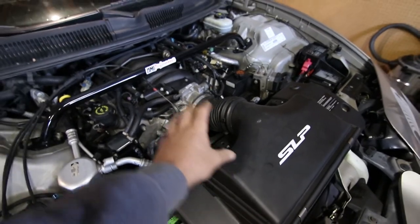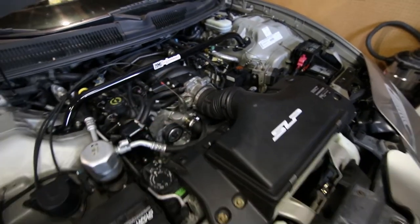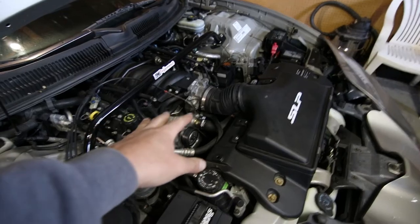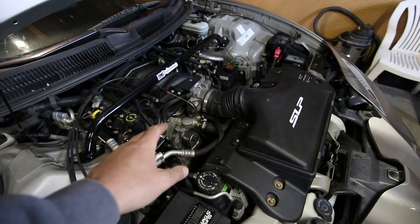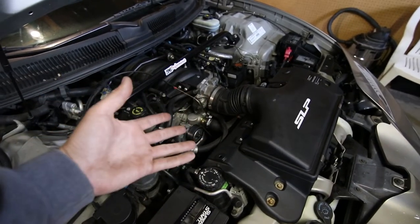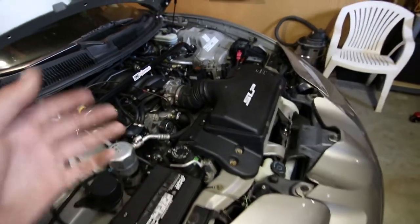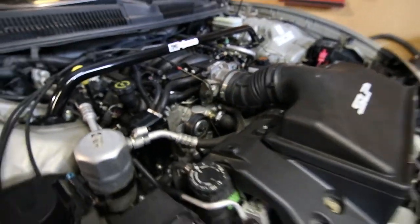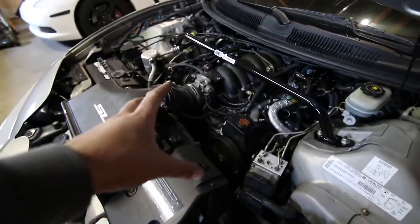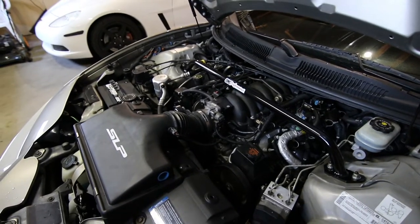All we're going to do is take off the lid for ease of installation, take off the bellows, and hook those two hoses together — should just take a couple minutes. Be really careful when it's warm; it says right in the instructions to do this when it's cool because you might get doused with coolant. I've also got little rubber vacuum caps to cover the coolant ports on the throttle body when I'm all done — gives a cleaner look, and if anyone wants to hook it back up it won't be full of dirt.